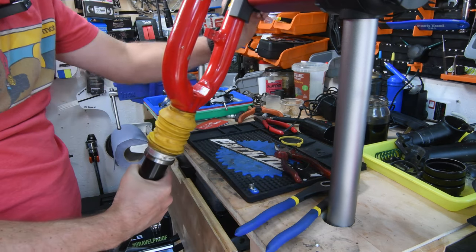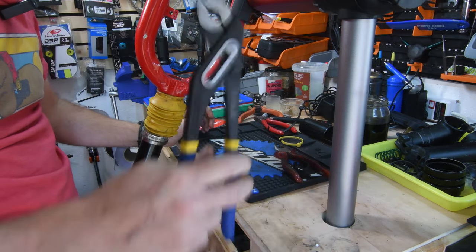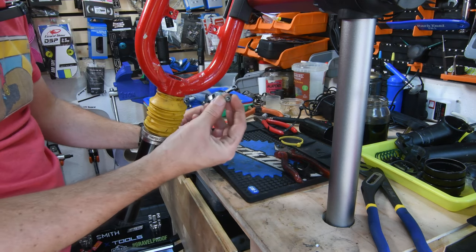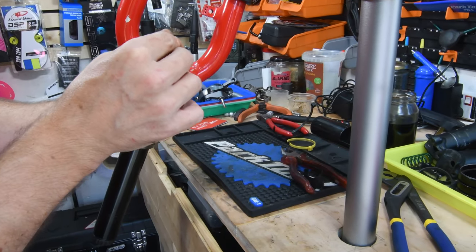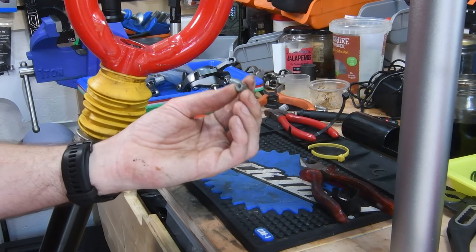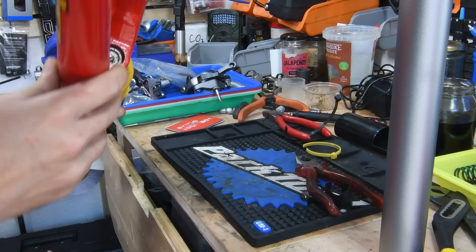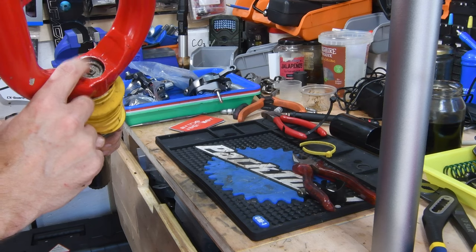Oh dear. So first bit of bad news. I got out some slightly bigger pipe wrench and started to slowly work the cap back and forth, and I got it off. But the problem is it was completely corroded onto the threads. So the actual inflator head or cap of the shock is now damaged, so I'm going to have to replace this part. Still holds air though, so I can still somehow inflate it, but I will need to replace that.